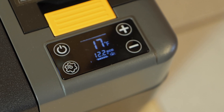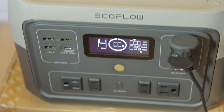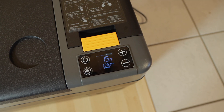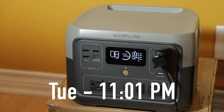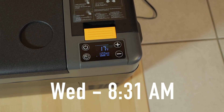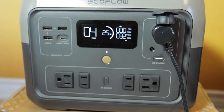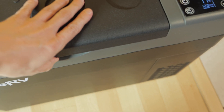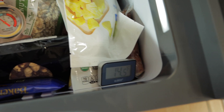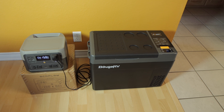So we're starting the test — it's at 17 degrees Fahrenheit and we're going to wait to see if the compressor can cool it down to 15 and shut off. We're still at 100% battery. Quick check-ins show 98%, then 15 degrees achieved, then at 55% battery it's indicating 17 degrees with the compressor on. At 25% battery, internal temperature is 14.5 degrees on one thermometer and 16 to 17 degrees on the other. I'll check in once again once the battery is dead.